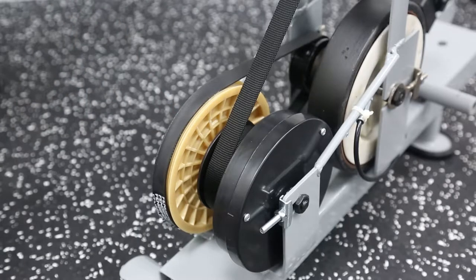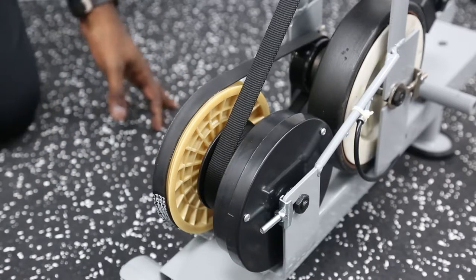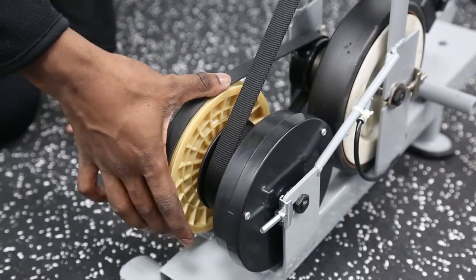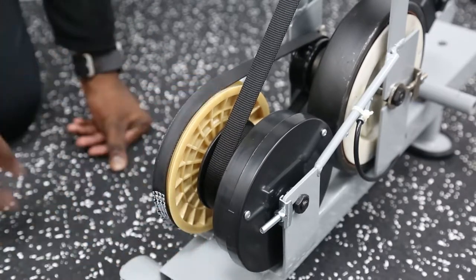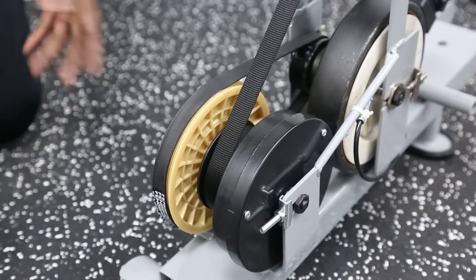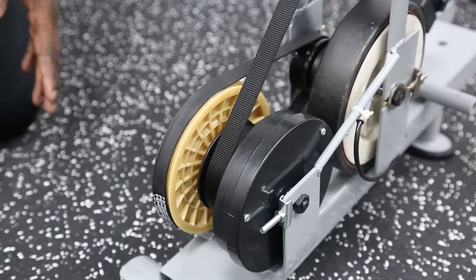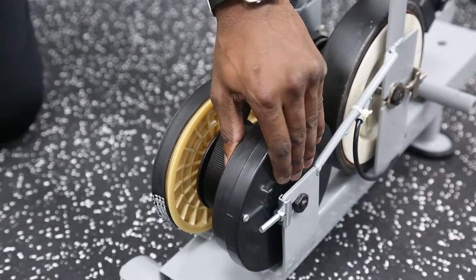If you're coming across an issue where your cord is stuck, the first thing you want to do is get your casing off your base first, then double check your belt. If the belt's not on correctly, that could be the reason why it's stiff. The best thing to do is take the belt off first, just to make sure the cord goes back to its closest point. If it doesn't go back and it's still sticking out, then it would be the actual component that needs to be changed.